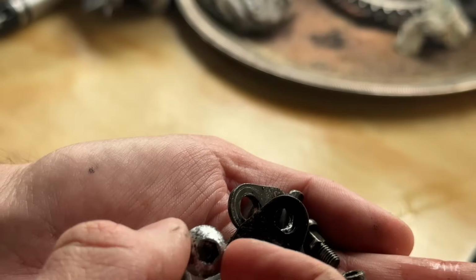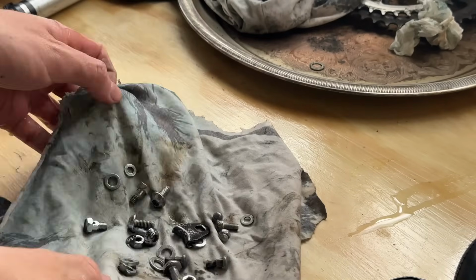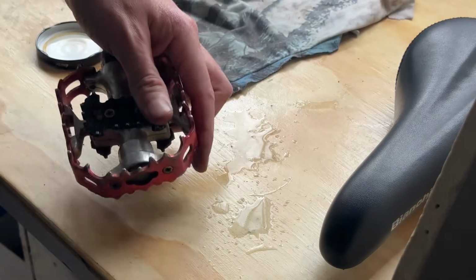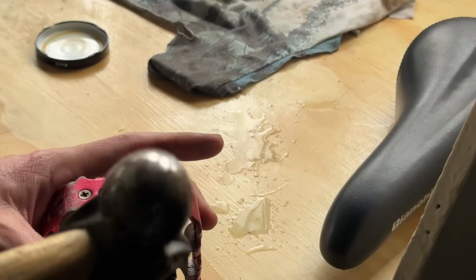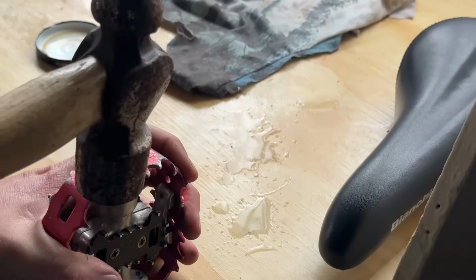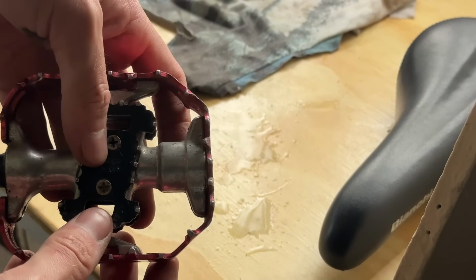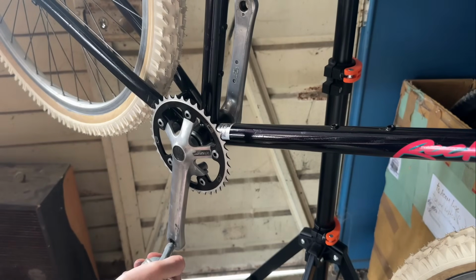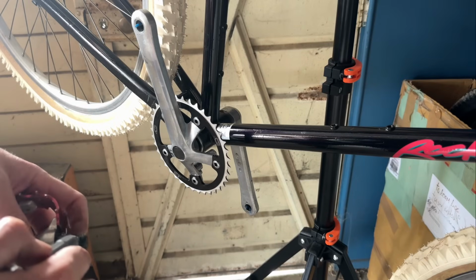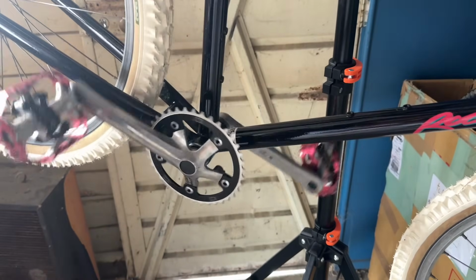These are all the bolts and everything out of the vapor rust. Now that we need the brake bolts, just going to give them a bit of a wipe up. And then we'll go over with some clear coat as well. While the clear coat's drying, just give this a bit of a... Just a few light taps, just to flatten that out. It's kind of risky reforming alloy of any kind, just because it could crack. It's not like steel where you can bend it a bunch of different times and it'll... It should be okay.